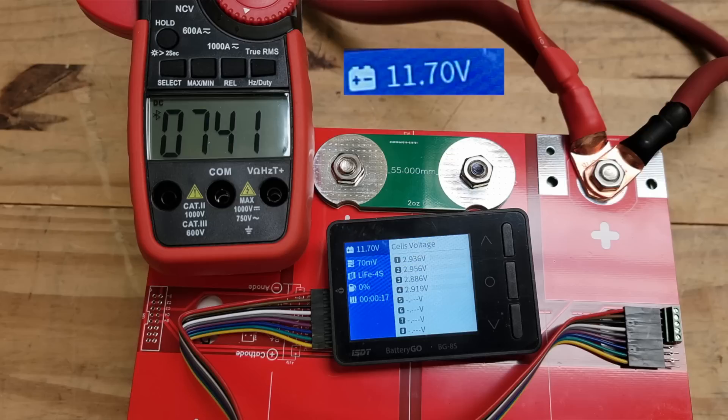It held above 600 — around 630 amps — for 10 seconds after that ramp. Adding that up, this battery could probably do closer to 20 seconds of burst at 600 amps, which makes them perfect for automotive audio. Audio loads are dynamic — maybe pulling 100 amps and then boom, 600 amps when the bass hits. It's like a 50% duty cycle, hitting 600 then dropping to 400, a hundred times a second. At one point we saw 750 amps, which brought voltage down to about 11.7 volts, but that was a continuous test.